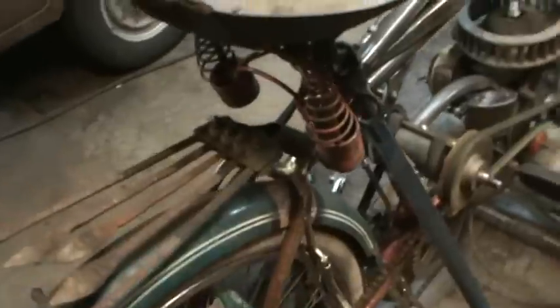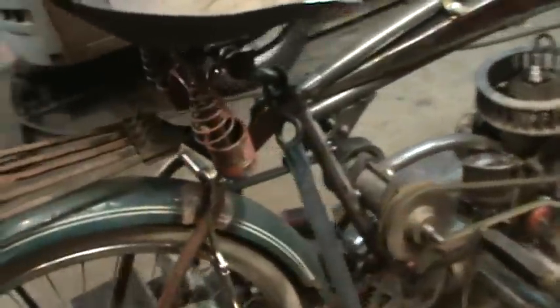And I heated up the fender to get it to wrap around a little bit better, so now it kind of fits in the center down in there. And I just got 2 pair of vice grips holding it right now, but that lines up to the factory hole, so that'll bolt the fender back on, no problem.